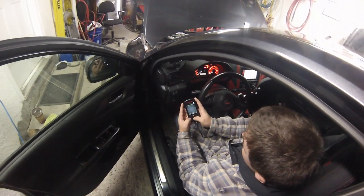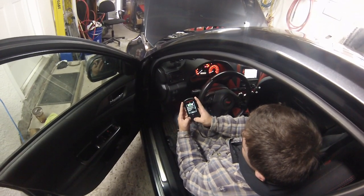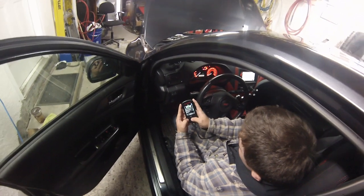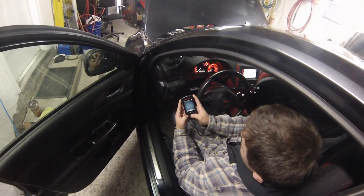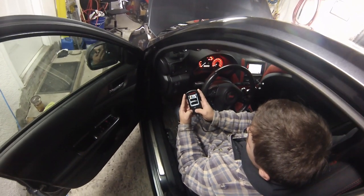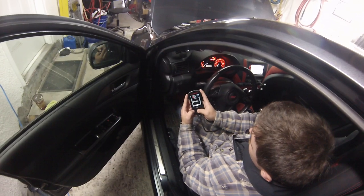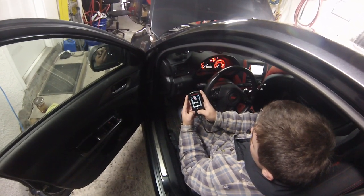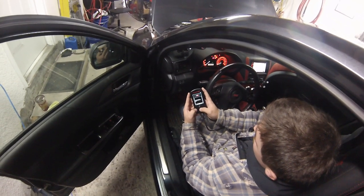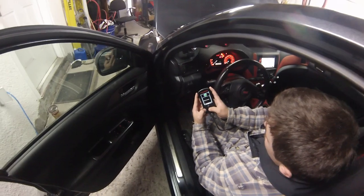It's actually surprising how quickly it will go in. So he's got to take a previous dyno tune that was on the car out of it, that's rated for the factory injectors. Just because we want this car to start up, idle properly, and actually be able to drive. And that should be it.